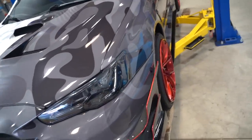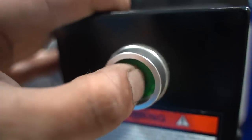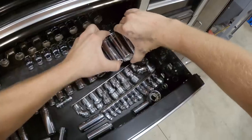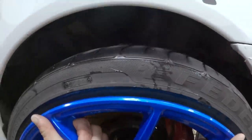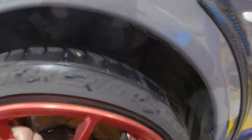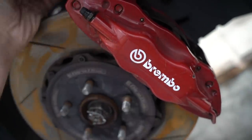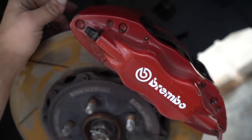Let's go ahead and pop off the wheels, and then we need to remove the calipers. Not all that long ago we did new pads and had the rotors resurfaced, so as long as the pads still have plenty of life left I'm just gonna leave them. I might be coating the rotors — just the hub part. We'll see when we tear it all apart. Two bolts on the backside hold the caliper onto the spindle, and then one bolt for the brake line, and the caliper comes off.